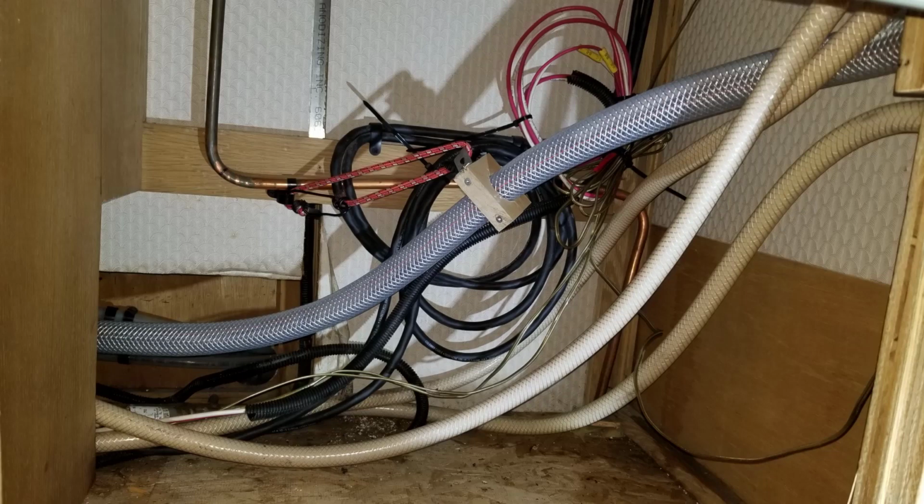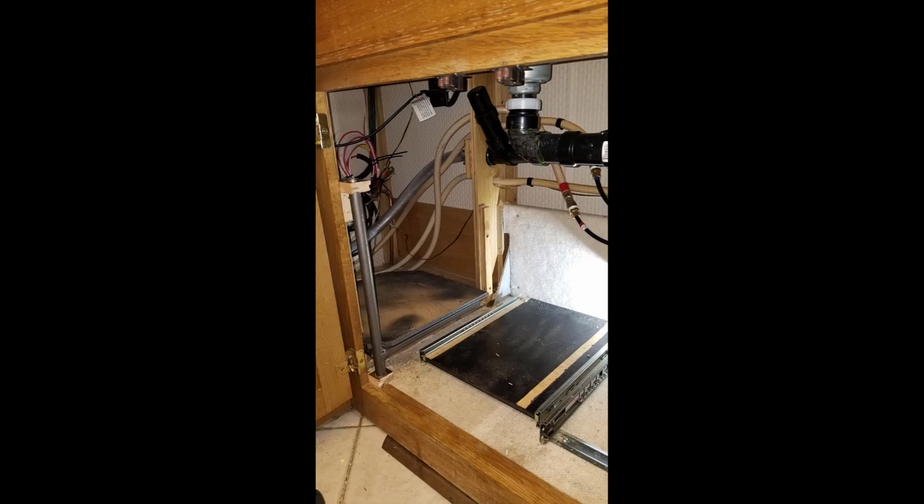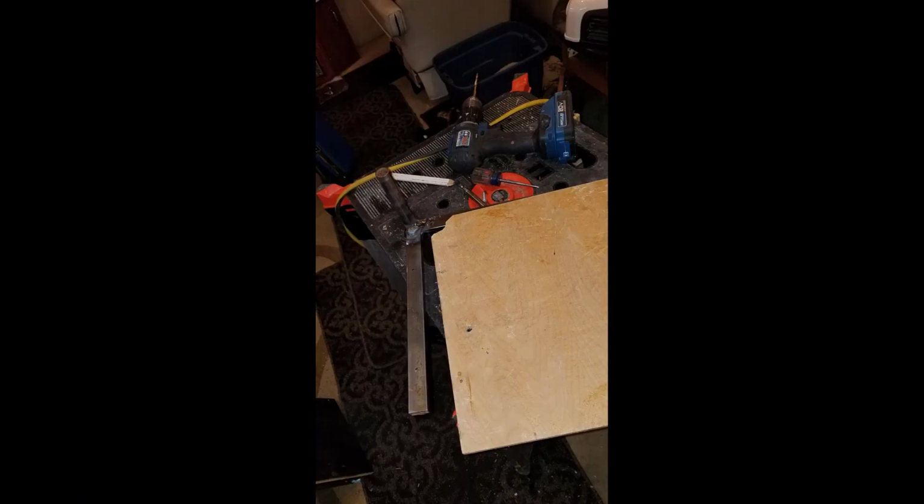Here is the P-trap. Instead of coming sideways and straight at an angle, which I don't know if they would do that, this thing goes straight to the back, runs along the back wall and through at the back corner. That allows you to put all this extra equipment in here. What I did for this corner piece, because now I'd freed up the opening under the corner of the sink, is I made a triangular rotating bracket or carrier on a piece of pipe.